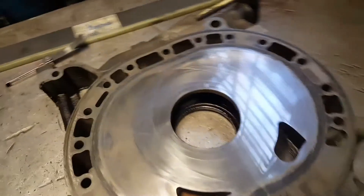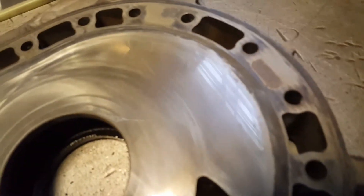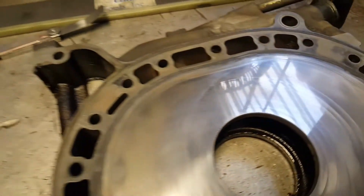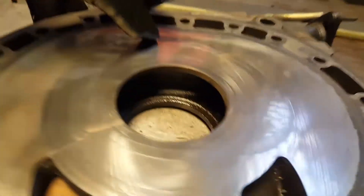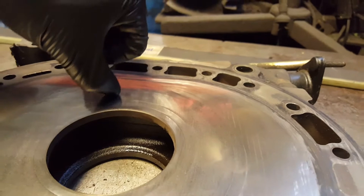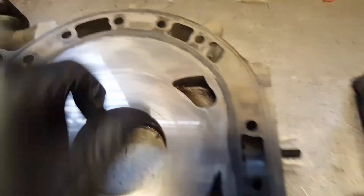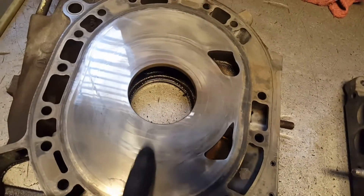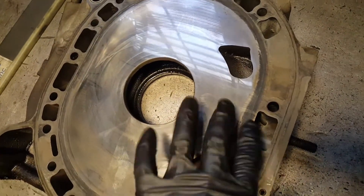On the face of the iron, look for grooves, any corrosion, or water damage. You'll see lines, but if they're shallow, the way to check is to run your thumbnail across — if it doesn't get stuck, there are no heavy grooves. Even though there seem to be markings, if there are no waves or grooves, the iron is okay.